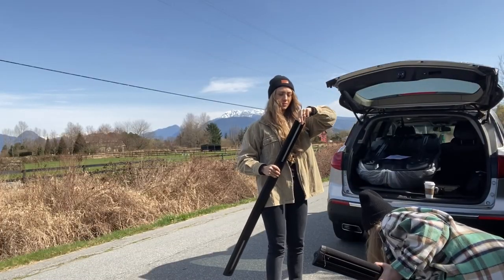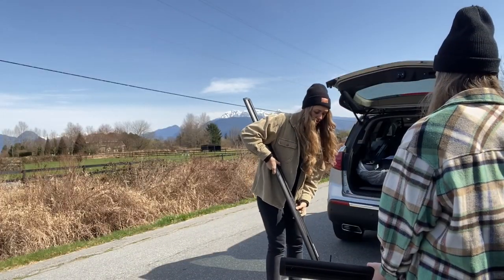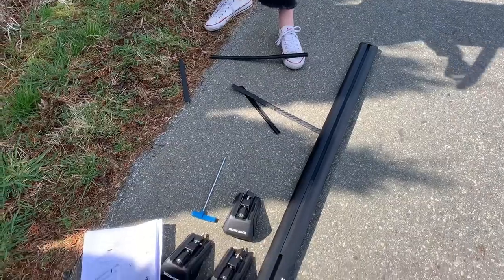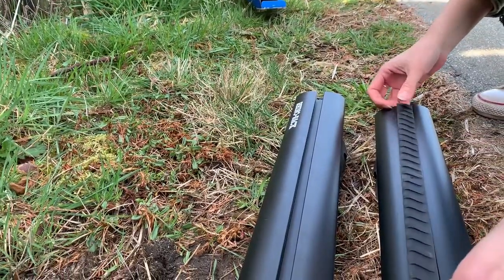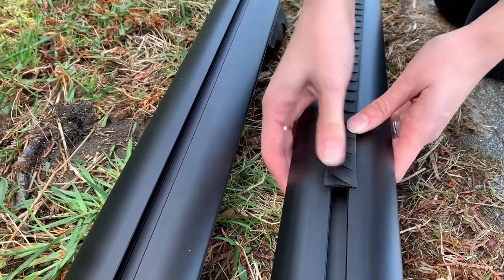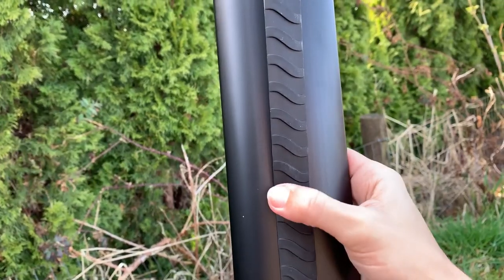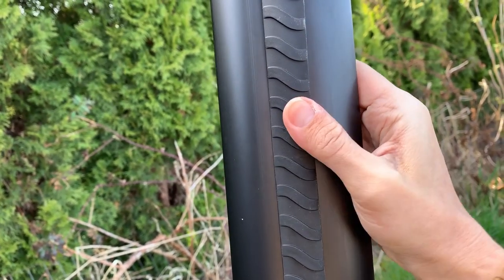Then remove the end caps from your crossbars, shake them up and down to remove the measurement strips, the Vortex rubber strips, and the key. Insert the Vortex rubber strips in the C channel on the top of the crossbars and cut the extra bit off if required. We discovered we like this back and forth motion to get them in just right.